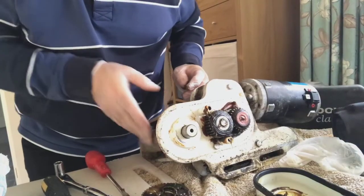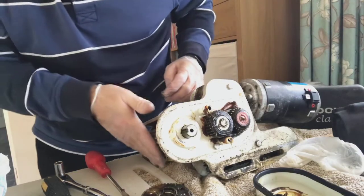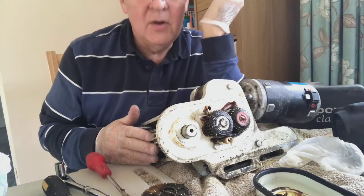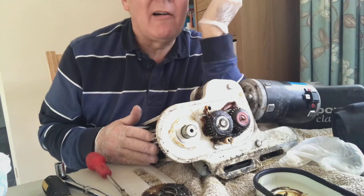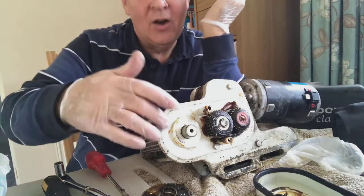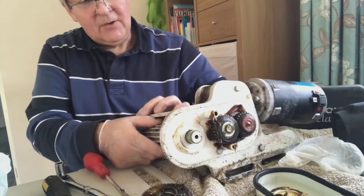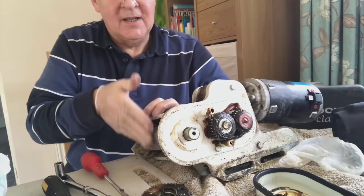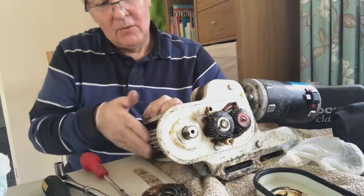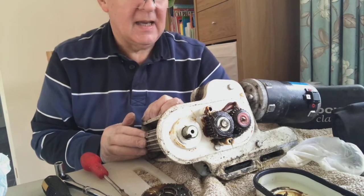But basically, guys, there's nothing wrong with those bearings at all. Bear in mind, when I did the other side, the symptom was that when the motor mover was engaged, it would make a terrible noise. When I took the roller off, the bearing on the larger side was absolutely seized up. It wouldn't rotate at all. But quite frankly, that's lovely and smooth. So I'm not going to bother replacing that. I think that'd be a waste of money, really. What I shall do is re-grease the whole thing and just reassemble it, and go from there, basically.